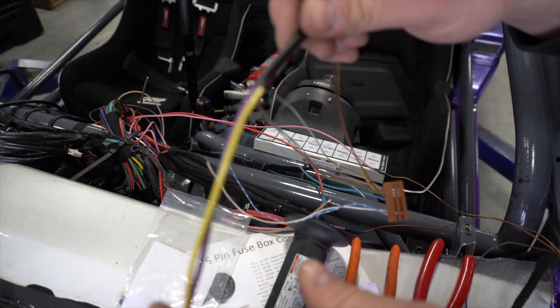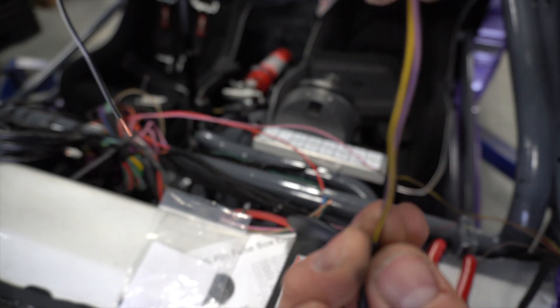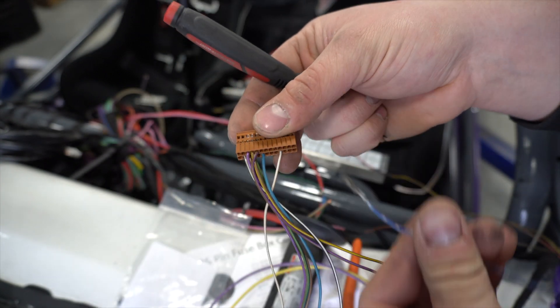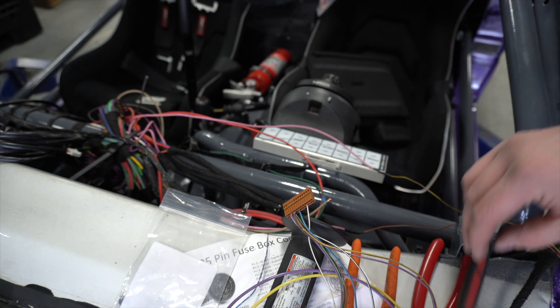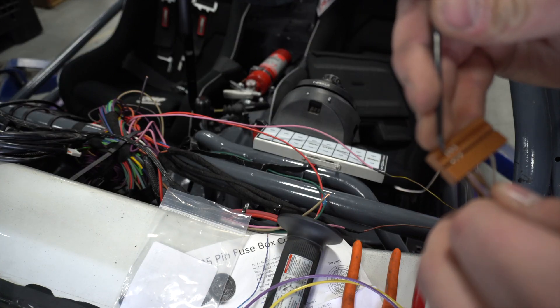So we've started on the wiring. I don't have any super fancy wiring — I'm using some 14 gauge stuff that I just have. This is brown with yellow tracer so I used yellow, brown with purple tracer so I used purple — it kind of works and I should be able to have this memorized later on. To de-pin you just push down on that tab and pull it through — they just snap back in if you ever want to reuse them. I save a few of these in case there are inputs I want to add later on. That's all I needed for that side of the cluster.